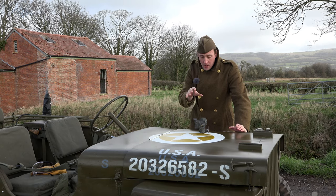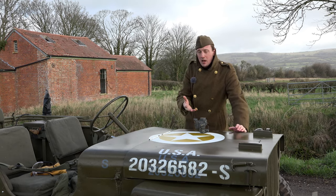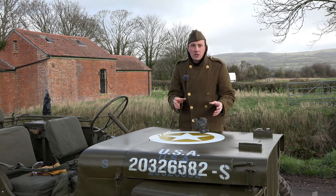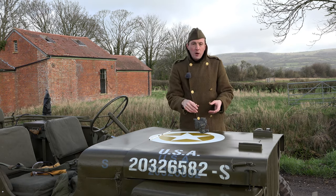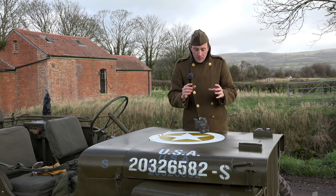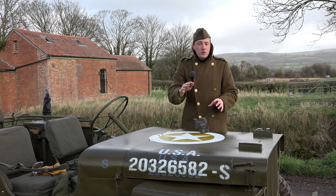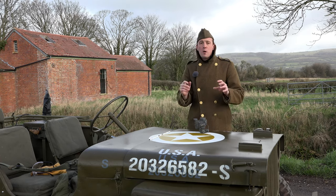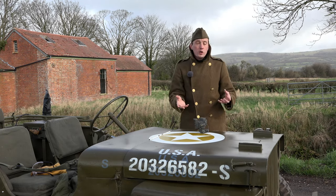These Solex carburetors are very good. Getting them to work in the first place was a bit of a job, so I'm pleased with that. The economy version works really nicely — you can't tell it's an economy version, really. You can only notice a difference when you're in second gear going about 10 mph and you mash the throttle: it will die momentarily and then pick up. From a standing start with a sudden throttle mash, it will also hesitate slightly before picking up. The WO doesn't do that — it sprays fuel in and off it goes. But if you push the throttle down gently rather than mashing it, you get constant power output. They're a little different, but very very good.